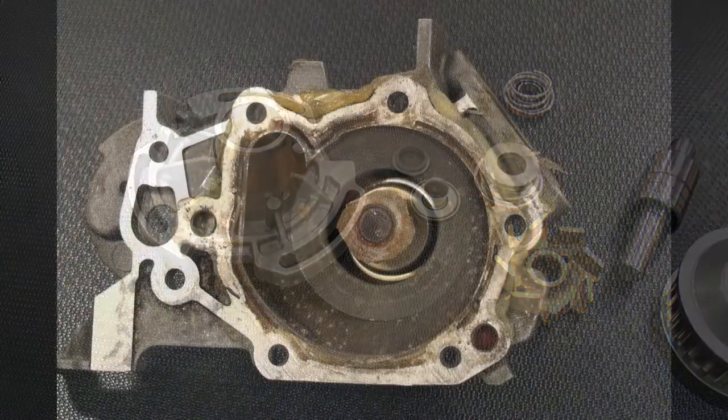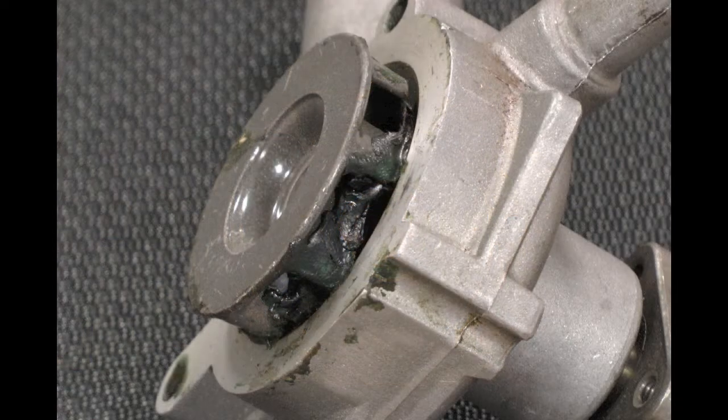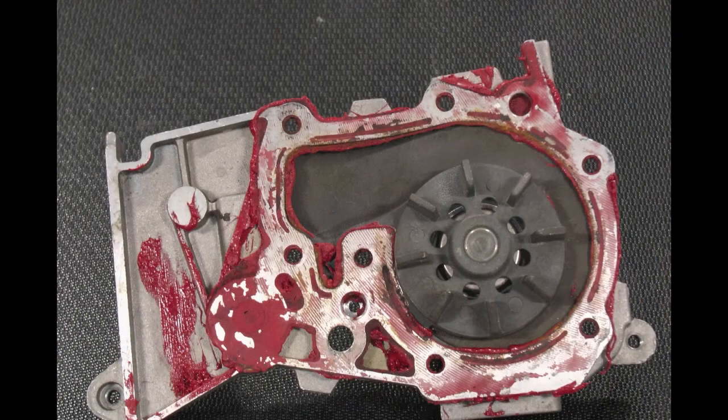If too much sealer or grease is used, it squeezes out the sides when the pump is torqued to spec and will contaminate the cooling system, eventually making its way into the dynamic seal pack with catastrophic effects on the seal pack, which result in leakage. Now we will see some genuine images of pumps that have been returned under warranty.